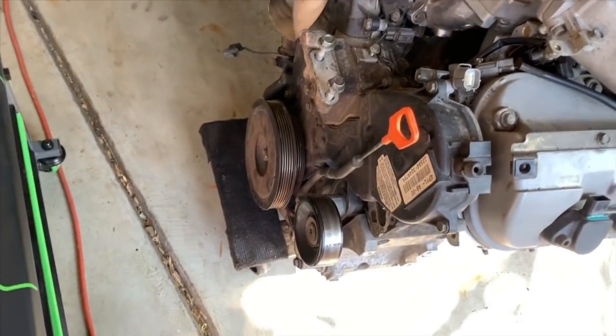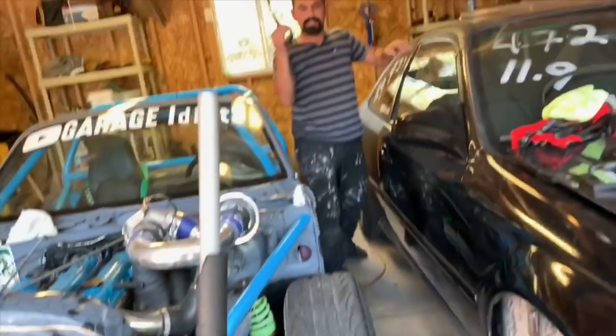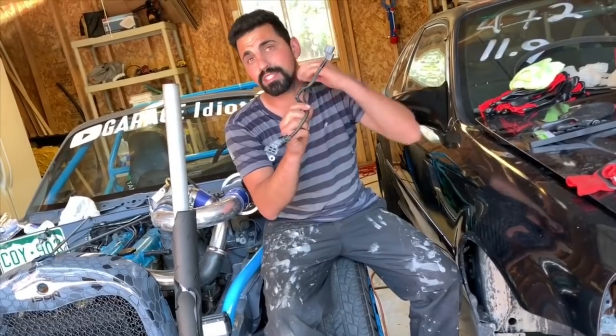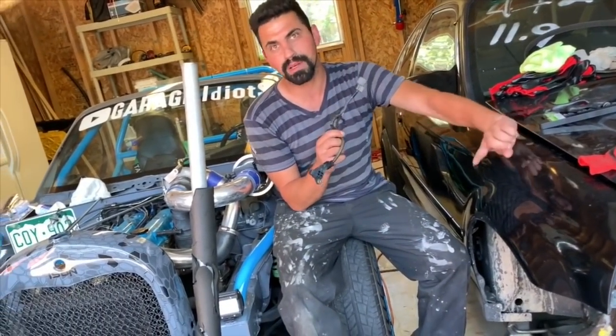So, this is a crankshaft position sensor that's shot. That's what happened. That's why we had to send the ECU back to AEM to switch. And we can put that right onto here. That'll go, yeah. The only thing is that the timing belt has to come off.